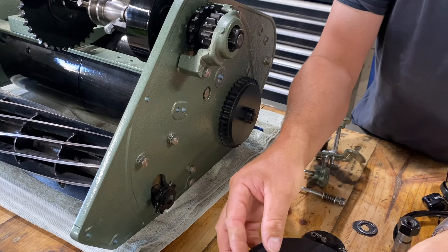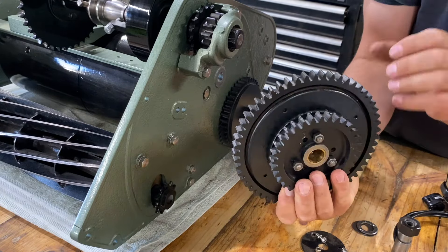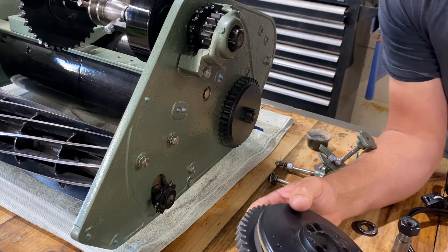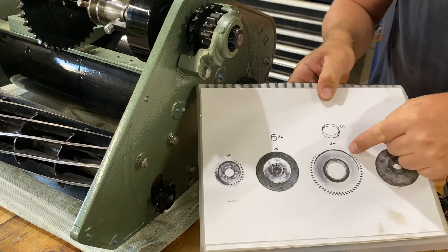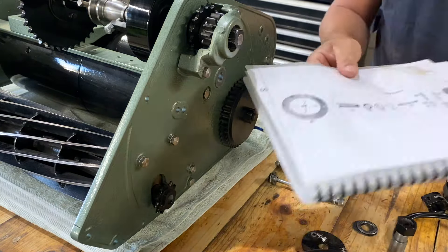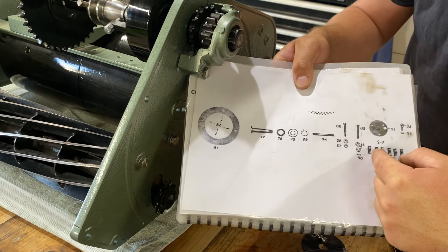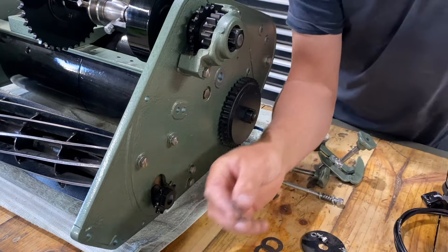This system has been completely reversed. We've got cork clutches on there like on the model 45 — that was more to do away with the asbestos. All our bushes are good. We've got all the information on here: all our ordering shows your gears, your bushes, and on the back page we've got the clutch pads, main shaft, the push rod that would disengage it — no longer needed — and these big old heavy springs that used to hold it engaged, which are also no longer required.